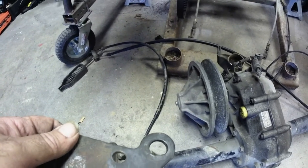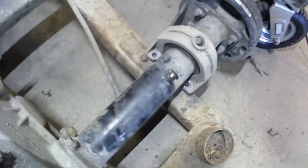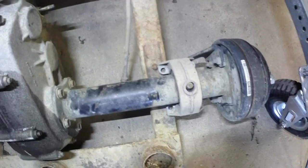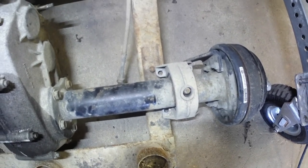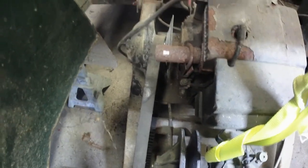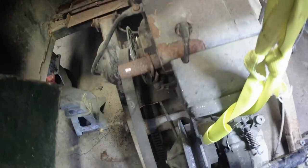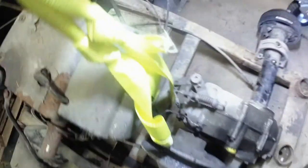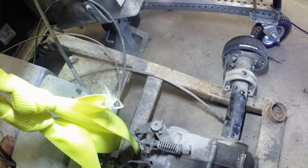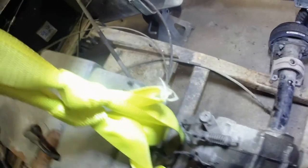Let's see if we can get these plates lined up and sitting on there and get this axle at least sitting in there somewhat square. New development — the original mounting places on the axle will not work in their current configuration, they're just a little bit too wide. Also, where the driven clutch on the rear end and the drive clutch on the motor are, they don't line up. There are some other holes in the engine plate down there — it looks like the motor can come over, so we can drill new holes.